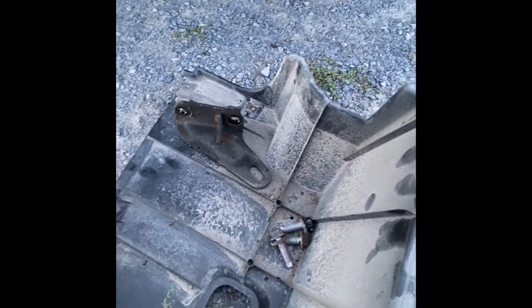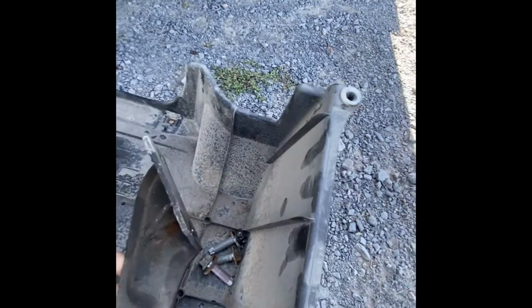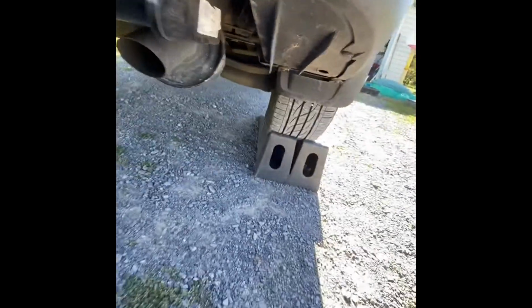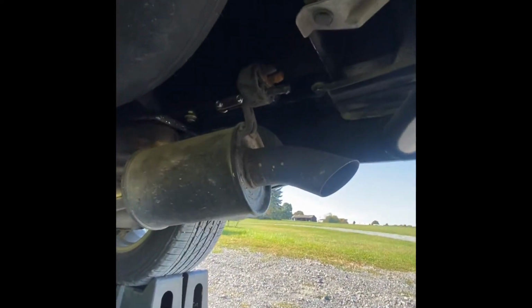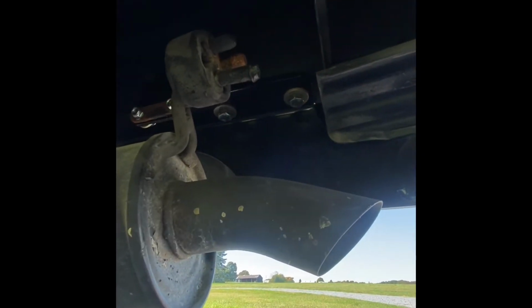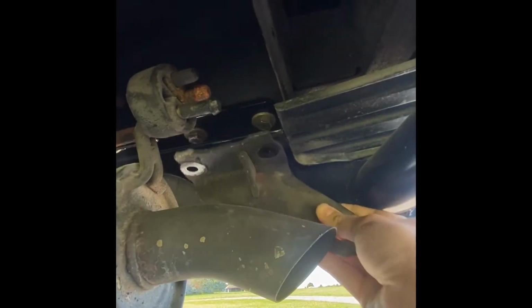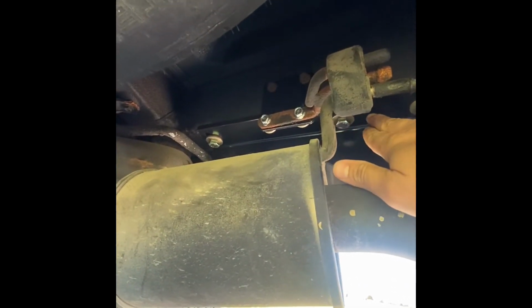So when you climb underneath, you're going to have a tow bracket sitting right up here. That'll be hanging up there, and these 2 bolts right there. So that will be sitting up there when you first look up here. So that's going to come off. Obviously, now that you have a hitch, you're not going to need that hook there. So you'll take that out.